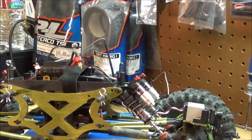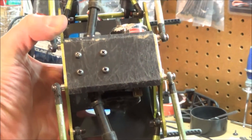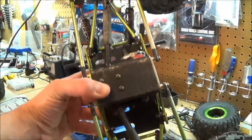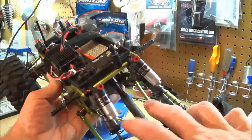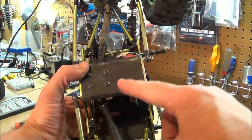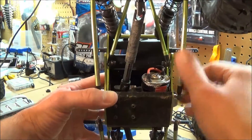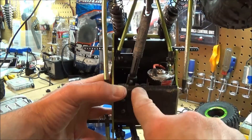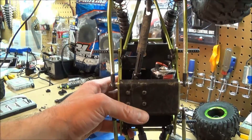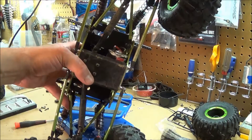I did notice a couple of things when I was working on this — the angles are giving me so much torque twist on this thing. The angles of the links aren't correct, and that's part of the reason. I need to put bent upper links on the top and these outer links need to come to the inside somehow. It's kind of hard to do with how the motor is sitting in there, so I need to get it more triangulated and have them come down toward the inside — that's probably why every time I barely touch the throttle this thing just goes.